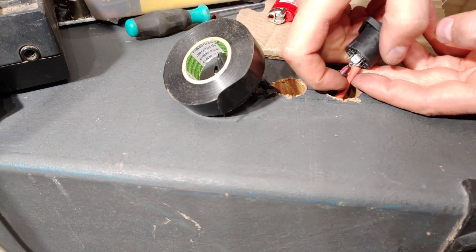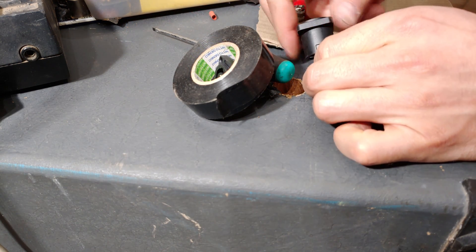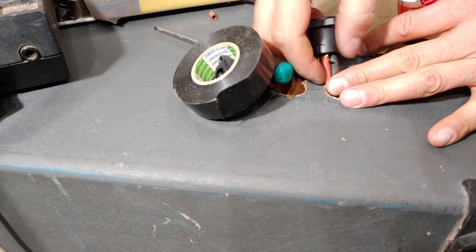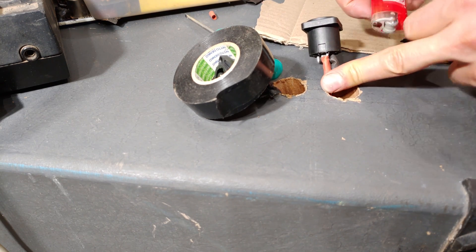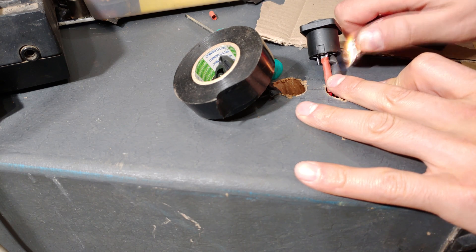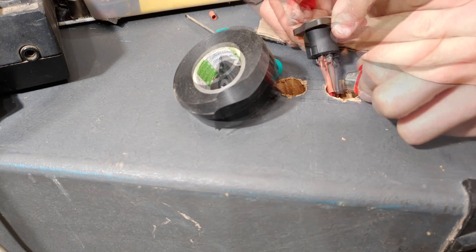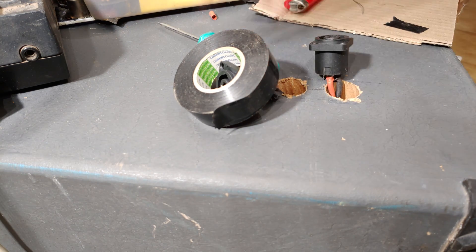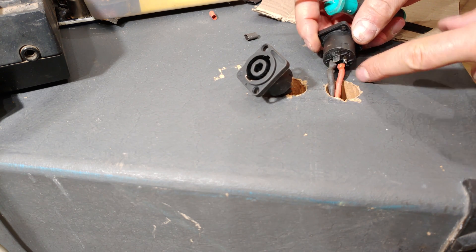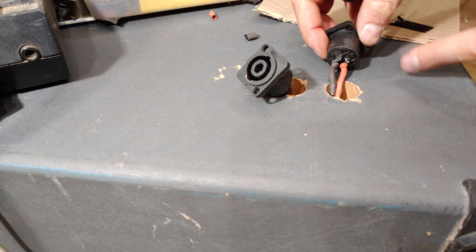I'll show you the heat shrink option. I'm going to pull the heat shrink right over the terminal. There you can see the two heat shrinks, and now all I need to do is light it with the lighter — just heat it up. Be careful, this is plastic, so don't hold it more than three seconds. There you can see the end product: the heat shrink is covering the terminal, they're far apart from each other, and I can get the entire screwdriver in there.